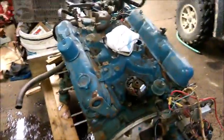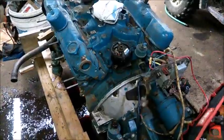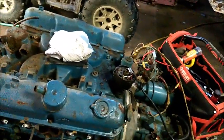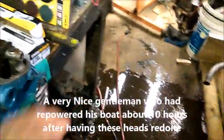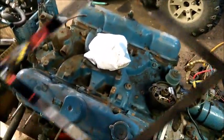This engine had four cylinders that were weak when I first started it up. After running it for a while, the pressure came up on all of them except one, and that one is why these heads would have gotten repaired had I not found a replacement set. I got these replacement heads off eBay — really reasonable — with valve jobs and new guide bars, no cracks. They've got about 10 hours on them from within the past year. I had to drive down into Kentucky to pick them up.